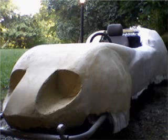Carefully mix the body filler with the hardener that is supplied. Follow the directions and be careful not to use too much hardener. Add too much hardener and in just a couple of minutes the filler will become unusable. Using a little less means the filler will take a little longer to completely cure. Not necessarily a bad thing if you're a novice.